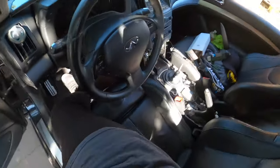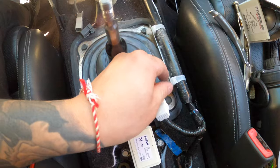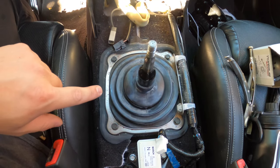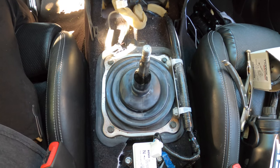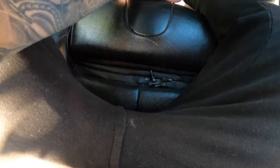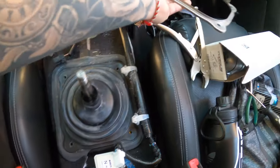This is exposed now, so we can continue. The next step is to take off all these bolts — these are 10 millimeter, as always on JDM cars and most cars. You'll also need a 12 later, which is under the car — I'll show you when we get there. After you get the four screws off, you can take off these pieces: start with the gray metal piece, then take off the rubber boots.